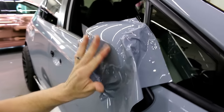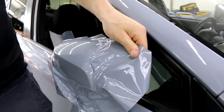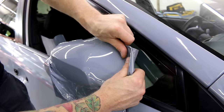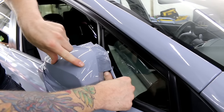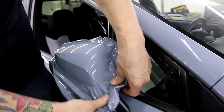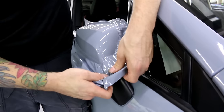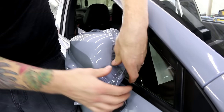For down here, we want to be extra careful and not stretch too much — we're going to let the film shrink a little bit. After I let it shrink, I want to bring it out and try to do as large a piece as possible. We don't want to keep stretching the film all the time. Here's where we're starting to build up tension, so I need to alleviate that. Shrinking, shrinking, shrunk. I'm just going to spread out the wrinkles and not stretch too hard to the edges — we just want it smooth.